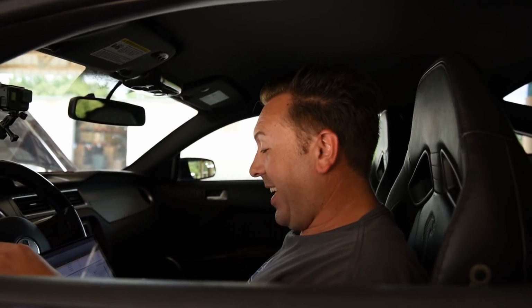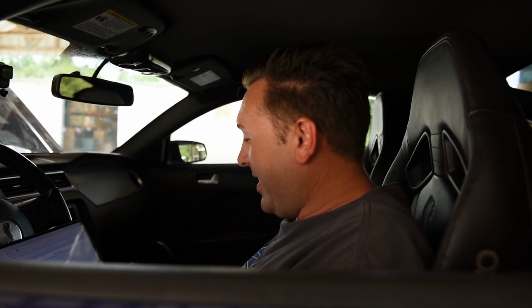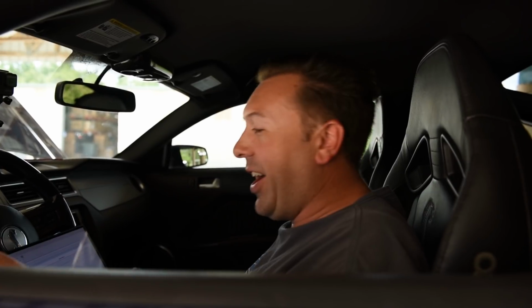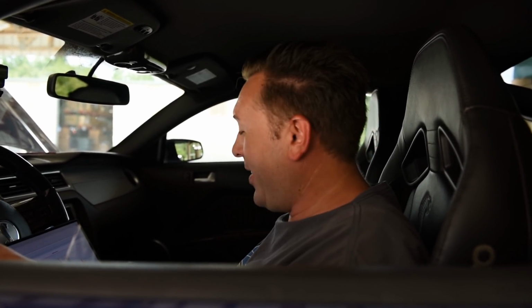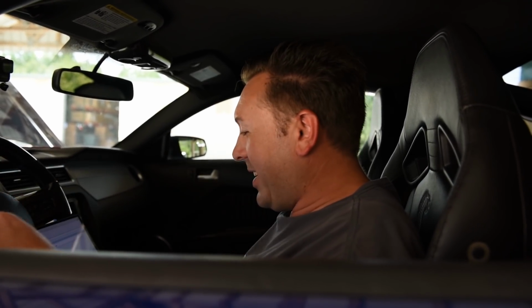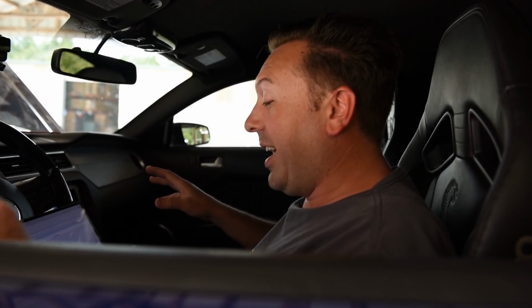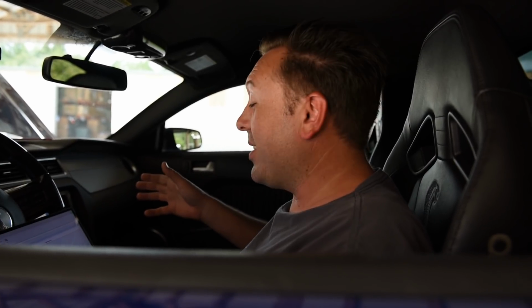All right, kids, adults, everybody, don't try this at home. The final pull, full BOOSTane timing curve, which was, let's see here. I'm so frazzled I gotta stop the data logger and find the dyno pull. Here we go, highlight. My hands are shaking a little bit. Okay. So, like I said, kids, adults, everybody, don't try this at home. 20.5 degrees of timing, considered pretty safe for BOOSTane on this 5.8 motor.